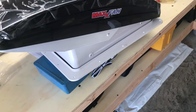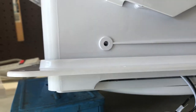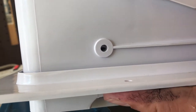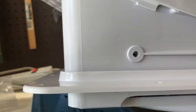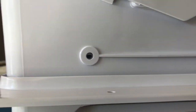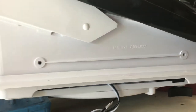I was having a little bit of trouble up there getting everything to line up, so I took it back down to the garage. The problem was I couldn't get to these holes with the fan on — they just weren't lining up. I got a tip from Adventure in a Backpack, who we've gotten a lot of tips from — thanks for all your advice and videos. If you just slide those metal receiving pieces for the screws up about an eighth of an inch, you can get them to line up with the hole in the plastic. I think it's going to drive the fan down once we start tightening up those screws.